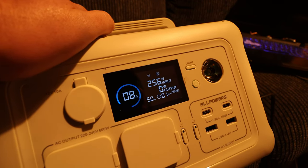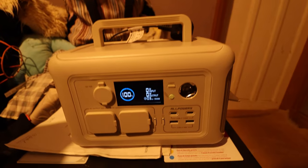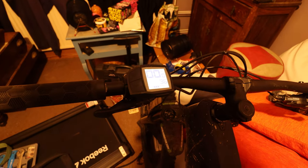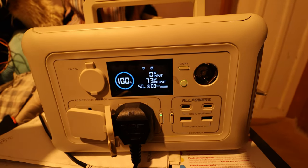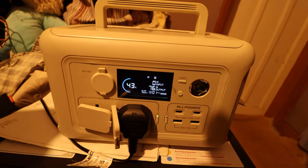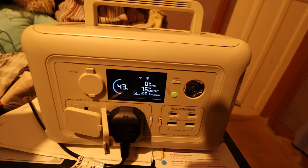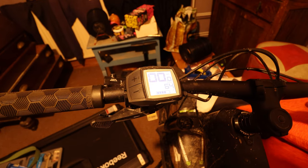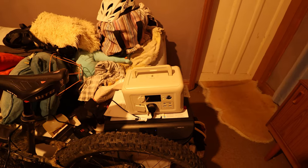We've now flattened it and it's time to recharge. No wonder it fast charges — 311 watts input now. It says recharge in one hour. So it looks like it gets faster, a bit like a rapid charger with a car. This is fully charged once again. If we look at this: three bars of charge, 36 miles of range in eco. With a bit of luck we'll be able to work out if this would be able to do it on a full charge. We're at 43% of battery, still about 75 watts output. It's got one hour left. And we're now at four bars — 95% has put on 28 miles. So you're talking a charge and a half to top up my bike. That's not bad, though it's not quite as good as I estimated.